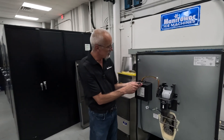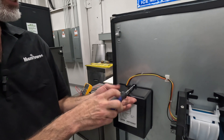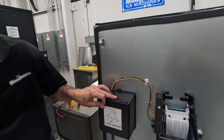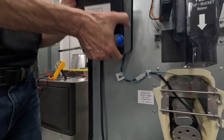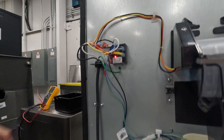Once we've got the front panel off of our dispenser, we're going to go ahead and remove the top screw on the area where we're covering up the agitation timer. There are also two small screws at the bottom. You don't have to remove those because they're on a slot — just loosen them and then lift this control box cover off of our agitation timer.